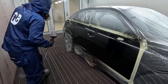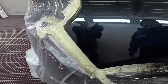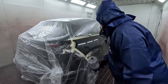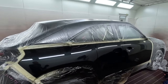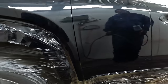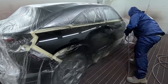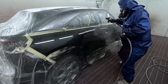Just check over it - make sure you're happy with it. I can already see at the top of that quarter panel it's a bit dry - see through there, just a little bit dry. Check yourself - get your eye in on the reflection, make sure you're happy with it. It does look pretty good. There's a little bit of orange through that door but I think it's probably okay - just a quick pass, not too much, I don't want you to run it. Just a bit of a wet-up, that's all - it'll give us a bit more material on there, which is a good thing.